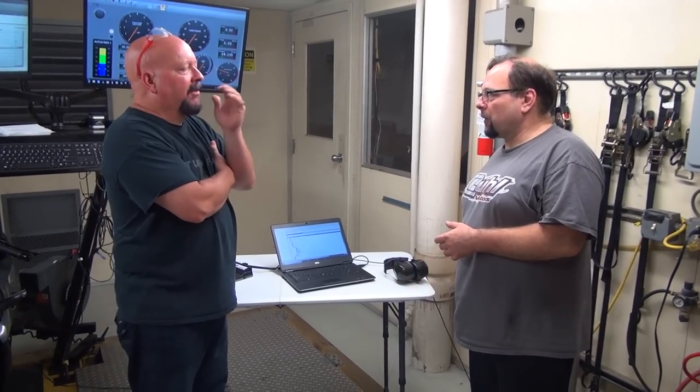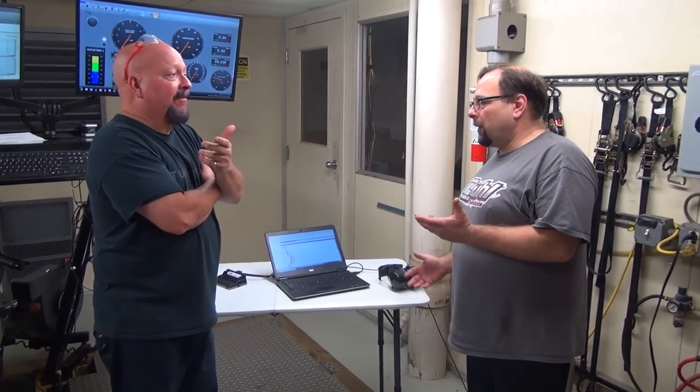I don't know what their capabilities are. But what we do, there's several different reasons why these things happen, and we have a lot of tools that we've built to get into ECUs before we know how to read them, to reverse engineer them, to get the code out. And with a lot of those tools we're able to go in and read other portions of the ECU where they store information, where they store error codes and stuff like that. There are other memory chips there that we have the tools to go in and edit and change. A lot of these tools you've developed. Yeah, the other guys just don't have those tools. Yeah, or they don't use them that way, or I don't know.